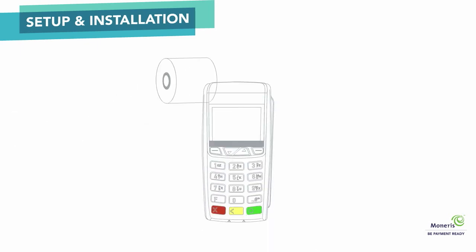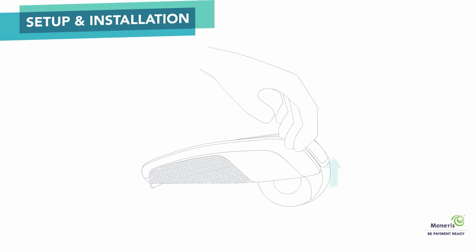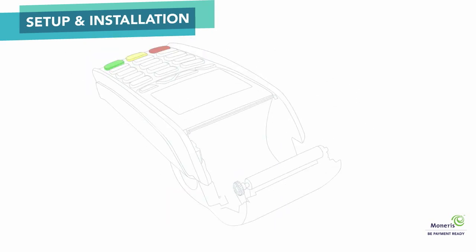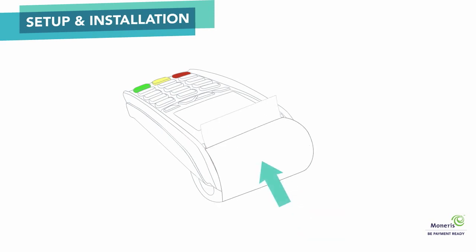Now, load the paper roll into your terminal. Open the paper roll holder at the top of the terminal by pulling up on the printer latch. Pull the latch away to completely open. Now, insert the paper roll into the terminal. The paper should unroll from the bottom of the roll towards the front of the terminal. Pull some of the paper up and press the printer latch closed.